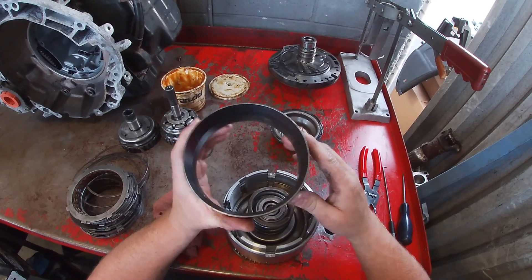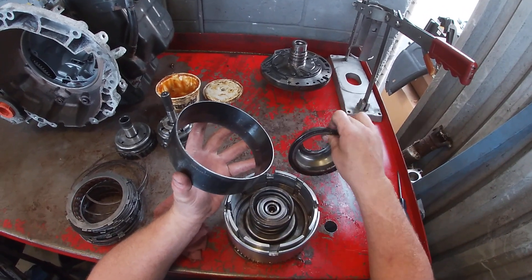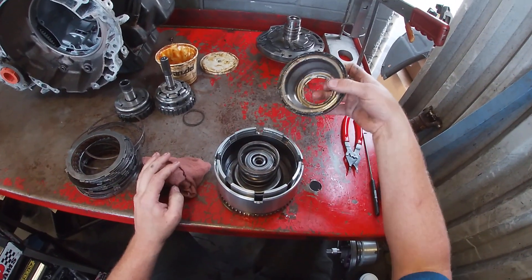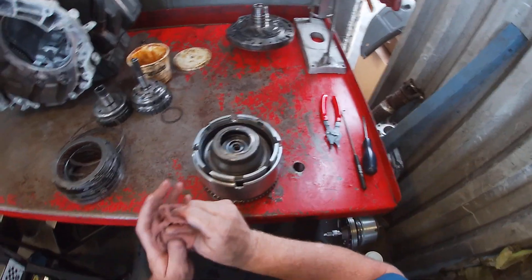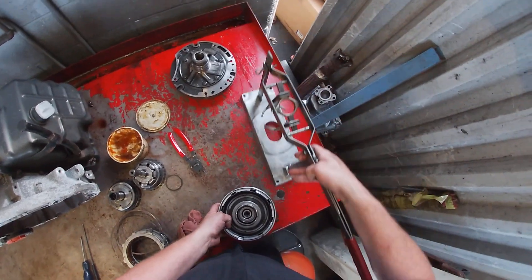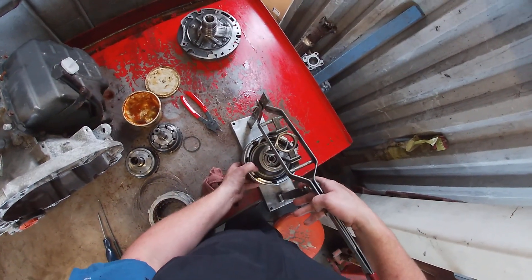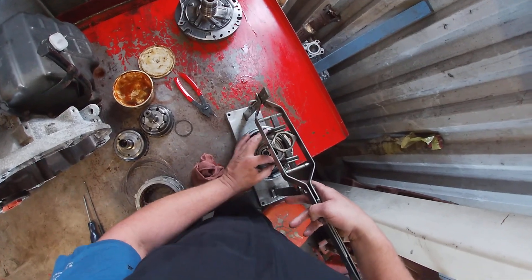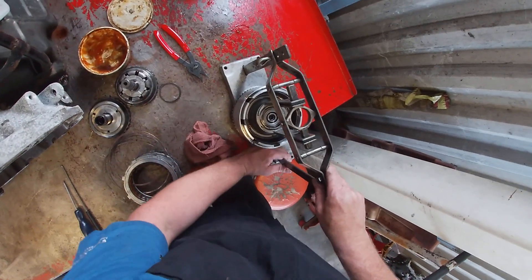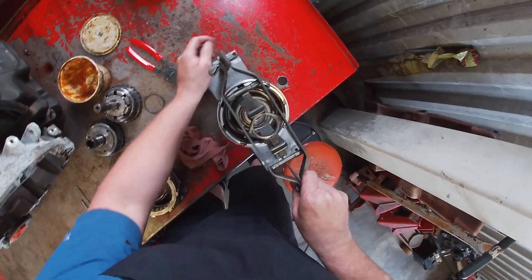This is our piston installer. It has a taper to it so that we can actually roll the piston down in without flipping the seal up or causing it to rip. You're going to drop it down into the drum until it's fully seated, and then we can use that to put our apply piston in. We're going to end up using the snap press. This can be a bit of a fight simply because the snap press doesn't press down in a straight vertical manner — it operates in an arc similar to a suspension component. So you have to anticipate that arc when pressing it down and get everything as aligned as you possibly can.